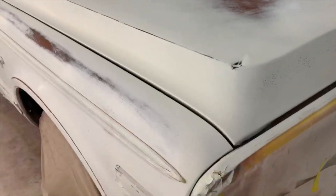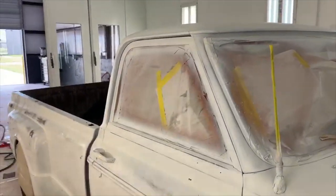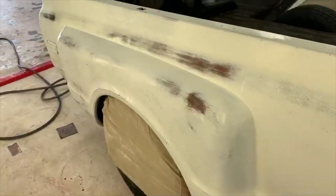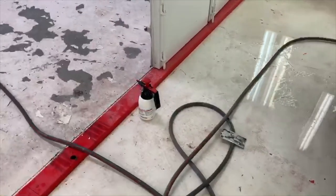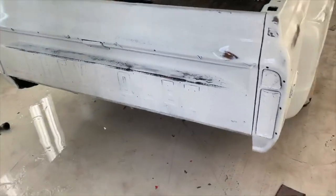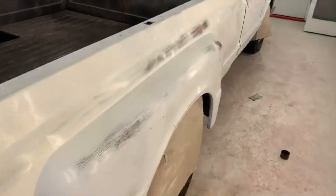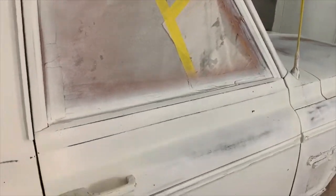I started on this side of the hood — I'm going to do a little more on the hood, it's fighting me a bit since I got the paint on a little thick. I've got the fenders, the door, up to the top of the door, and the side of the bed about where I want it. It's really shiny right now because it's wet — I've been wet sanding the hell out of this thing. In my spray bottle I've got some wax and grease remover, which helps break up the non-cleared paint in the tough areas. Look here where I sprayed some water — it looks like rock chips. That's a really good trick for you DIY guys.